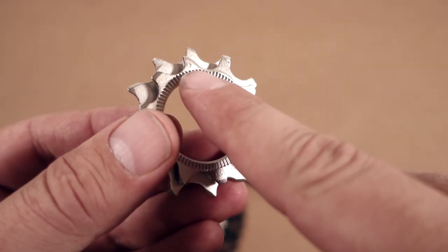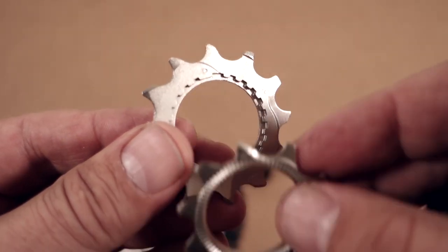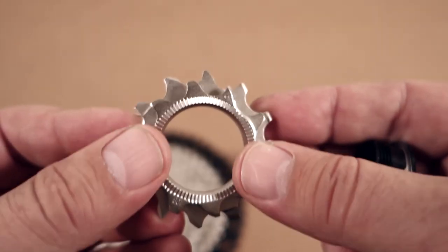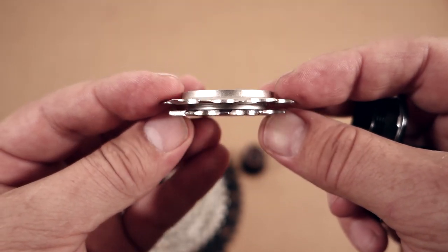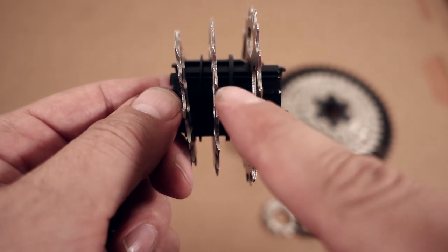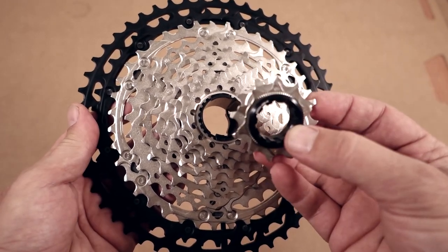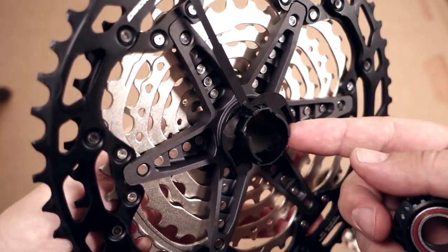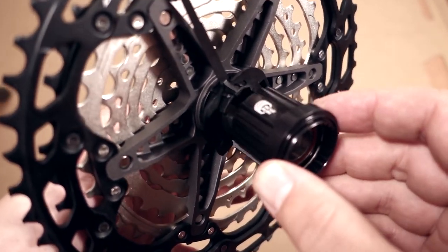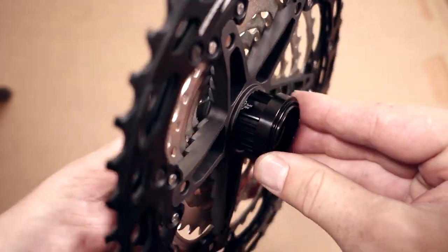The other thing is, if you're looking carefully here, there's a little dot on that 10 tooth cog. You see a corresponding dot here on the 12 tooth cog. You have to line them up when you install the cassette, because the 10 tooth actually locks onto the 12 tooth cog and not onto the freehub body at all. The only other gotcha is that the spacers used between the 14, 16, and 18 cogs — one is really thin, the other one is thicker as you see here. However, if you're just installing straight out of the box, you only have to worry about lining up the 10 and 12 tooth cogs. This holding tube and the tab is cleverly designed by Shimano to help with the installation — just line up your biggest groove here on the splines with the tab, and as you remove that one, you're going to see how your whole cassette slides onto it.